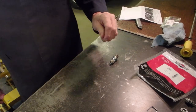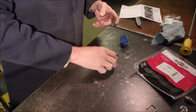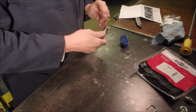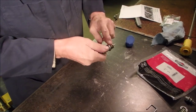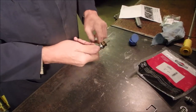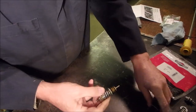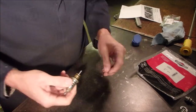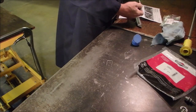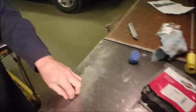Let's get that silicone. I'll be right back. So anyway, that was nice of them to send me the extra O-rings, hey? I call them washers, I believe, in the video, and all of the pump guys are probably cringing. But this is O-ring lubricant. Okay, we're going to need the old pin that holds it in. So, install new unloader, install the locking pin to the unloader housing, and that's it, baby. So come with me.